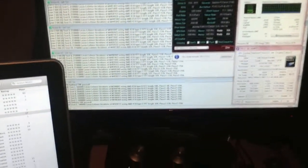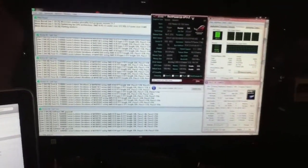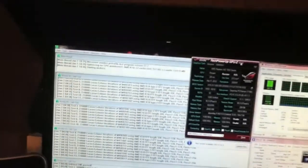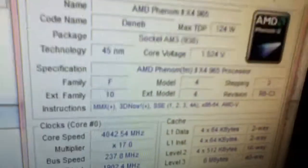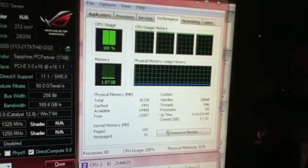What is up everybody, we are back again and today I'm going to run you guys through my PC setup really quick. Right now I am running Prime95 and I'm just doing my second round of stability testing. I actually had to drop my clock down from 4.2 to 4 flat. So that's what I'm running on my 965 four-core Phenom Black Edition. My Windows Task Manager has been running for a while, so that's what I've got for overclocking on my CPU.